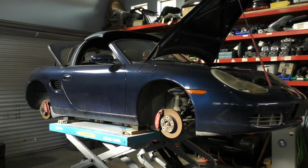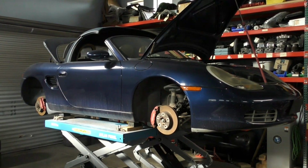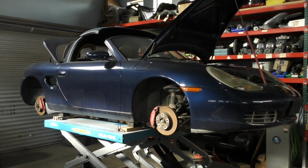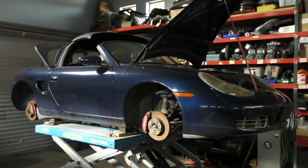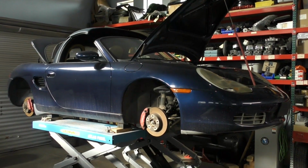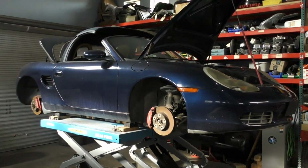Now, there are a couple of exceptions that are very rare. For example, a brand new tire that's been sitting on a shelf that's never seen daylight. That's something where you may go, well, maybe I'll use that for a little bit. But even if it's stored inside and covered, that rubber is aging. And so it is not going to work as well as a brand new tire.